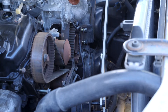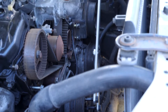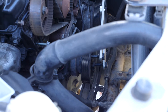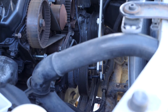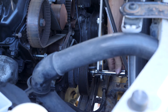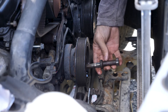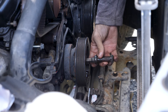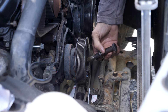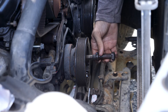I've got this tool hooked into the crankshaft pulley and I can hold it up there at the handle. What that's going to do is hold the crankshaft while I undo the nut on the end there. I finally got the crank bolt out and this thing was stuck — I mean really stuck on there. I had to get about a four foot length of pipe to add to my 18 inch breaker bar to get enough torque to break it, and I also had the help of my neighbor to help hold the crankshaft still.